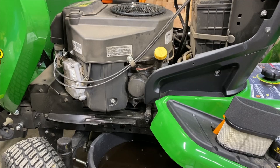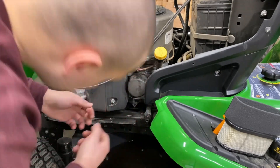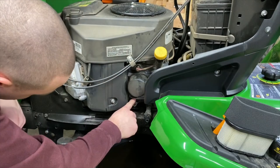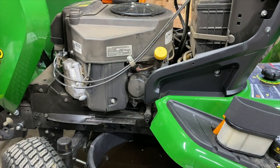Next is to place the drain pan or funnel under the oil filter tray, remove the old filter, wipe off the filter tray, put a light coat of fresh clean oil on the new filter gasket, install the replacement oil filter by turning it clockwise until the rubber gasket contacts the filter base, then tighten an additional half turn. I can already tell the tray is going to let oil seep right down onto the frame, so I'm actually going to grab a funnel real quick.